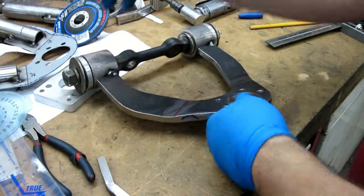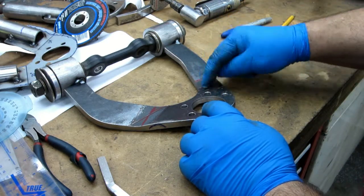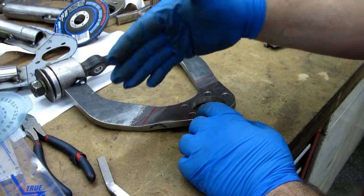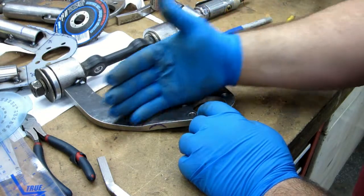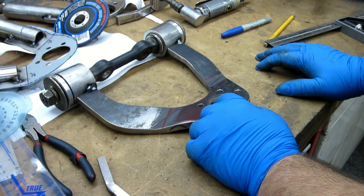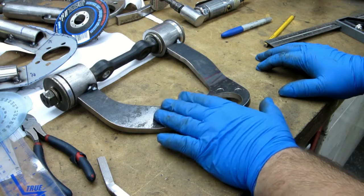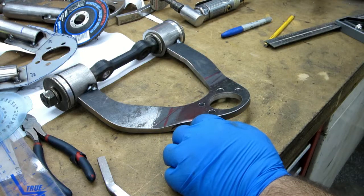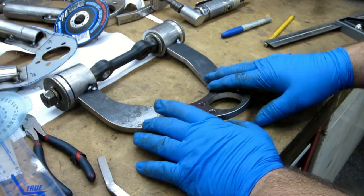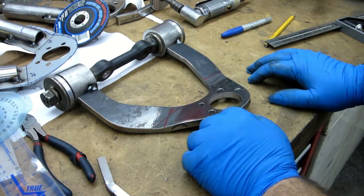So, you know, have to play with it a bit more. It might be the kind of thing where I need to bend it in a different die. Or the other option is get out the oxyacetylene torch and warm it up a bit, basically, and then bend it. And I think when I do that, I might have to, this is air bending because it's not actually getting pressed hard between the two dies for its shape. I don't remember what the other kind of bending was called, but I might have to make a die that fits the shape exactly. Or I might just have to pay the company laser cutting them to bend the ones I need bent.